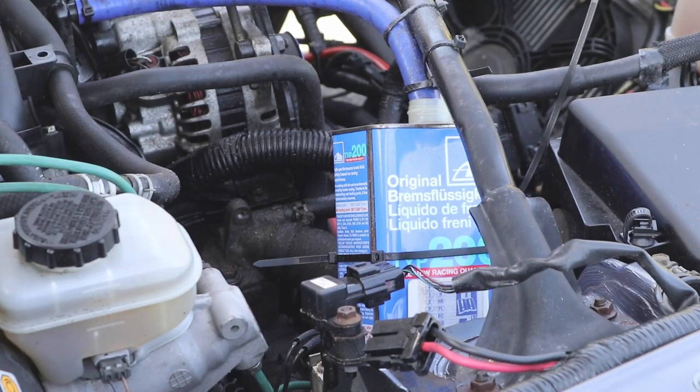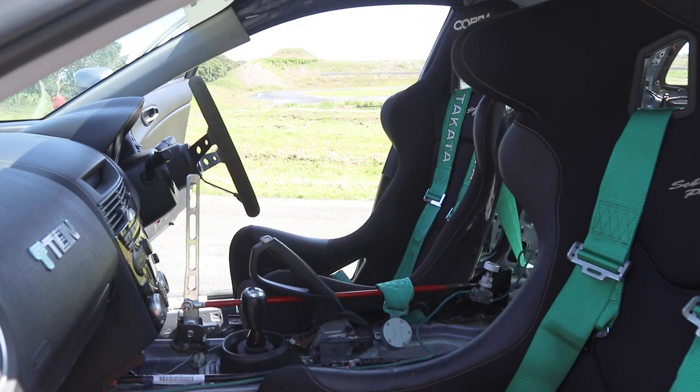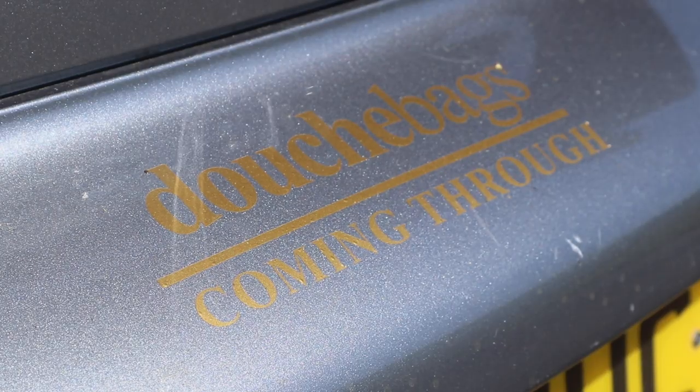Well, first rotary time, rotary life. How long have we got? So we went to Crail and I left the breather pipe off. I threw that in the bin because I don't need it, but rotaries supposedly breathe quite heavy. So then oil went everywhere and I didn't have this gator on, so the smoke came in here. Then when I accidentally spun and you went off at Crail, I could hardly see because there was so much fumes. So that was the main problem.